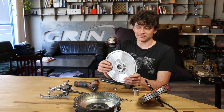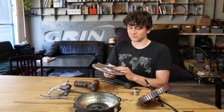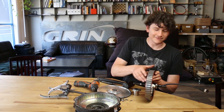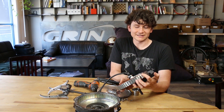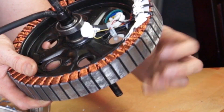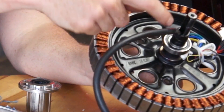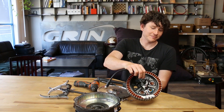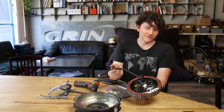If you're replacing the ball bearing, you now have access to the bearing in the side cover — press it out with a press or a dead blow hammer. With the stator itself, if you removed it to replace a hall sensor, the three hall sensors in this motor are just inserted into stator slots on the stator assembly. If you're opening it up because of a damaged cable harness, you have very easy access to the cable — it travels through a diagonal channel through the axle. If there was an axle spinout, you could cut the cables, pull the cable out, and replace it with a new motor cable to repair the motor.